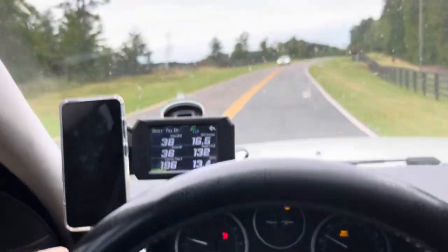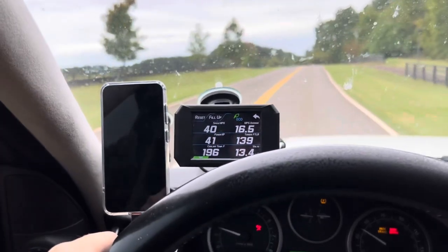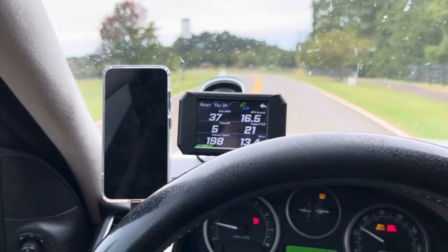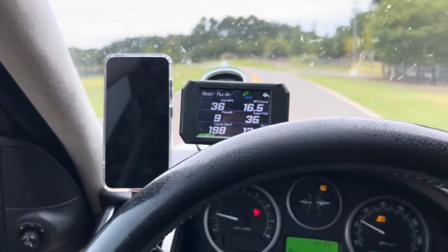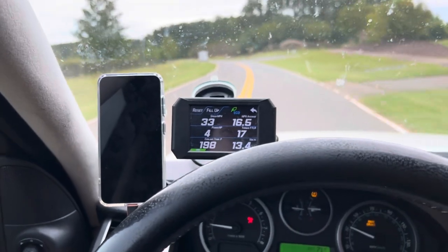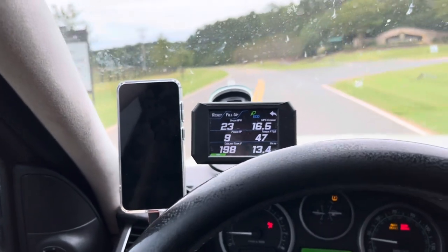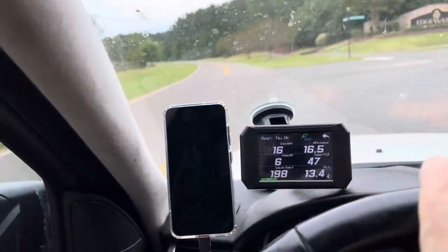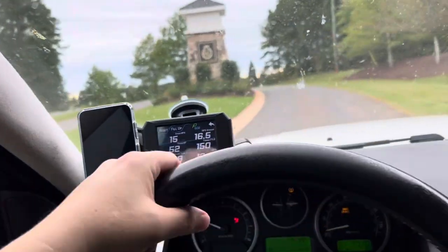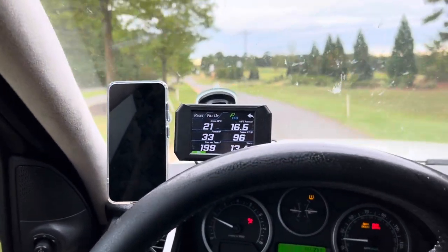And then I would like to observe to see if there's going to be any additional leakage happening. So at this point, as you can see, it's fluctuating between 196 and 198 degrees, which is really great. Prior to me doing what I just did, it would already be at about 205 to 217, especially when I start driving slower. So it remains to be seen whether or not this has actually helped.